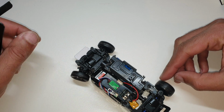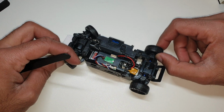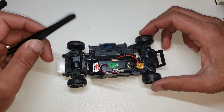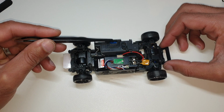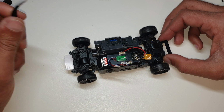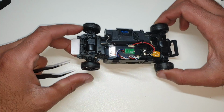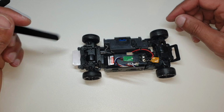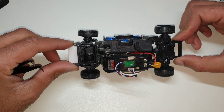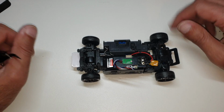And you'll see in the footage that as it's going around, especially in circles, you can see the front wheels steering, counter steering, as the name suggests, as it goes around. The counter steer setup also seems to eliminate to some degree the weight imbalance on these cars where the batteries are on this side. As you could see in the before video when I was on the tabletop, the car was spinning out one way more than the other no matter what I did. I checked all the wheels, checked the suspension, still it was spinning one way more than the other. Putting the front one-way diff in did help, but switching to the wide rears and narrow fronts with the LF3s and this setup, absolutely perfect.